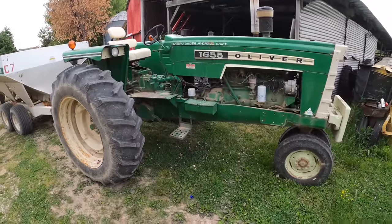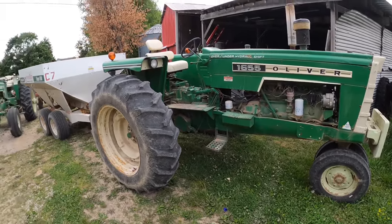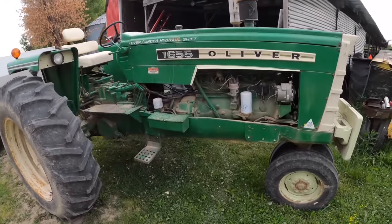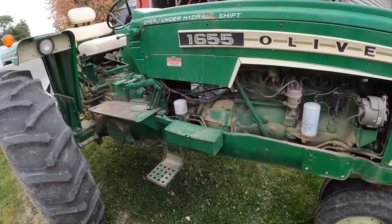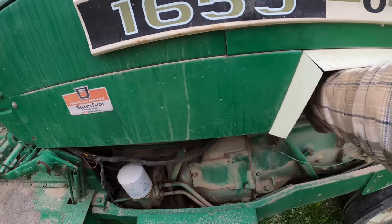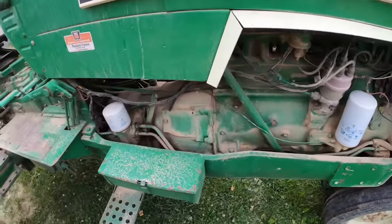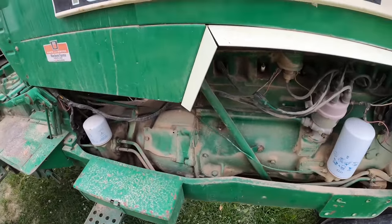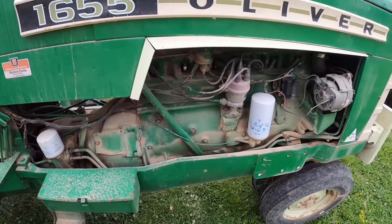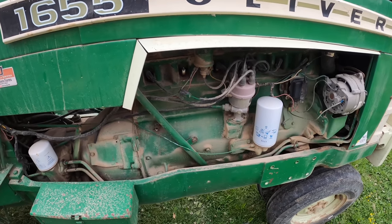All right, welcome back. If you haven't seen my videos before, I'm Ross the Oliver Man. And as you may recall, the other day we were spreading fertilizer with the 1655 and it developed a miss. After coming back here, I don't remember if I filmed that part or not, I determined that it is in fact cylinder number 5 that is doing nothing for us any longer. It is throwing a spark out of the wire. So step one I'm going to try is pulling that plug and hoping that bad things await under there and that a new plug will fix it.